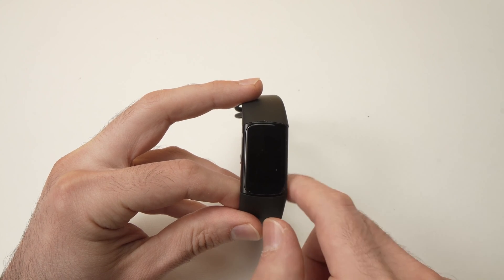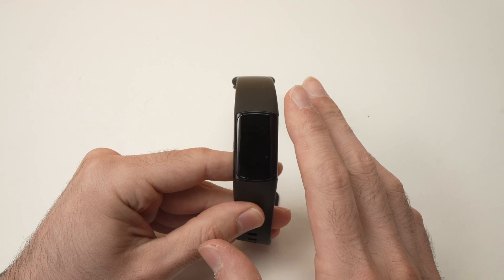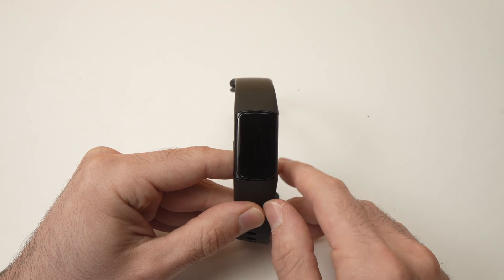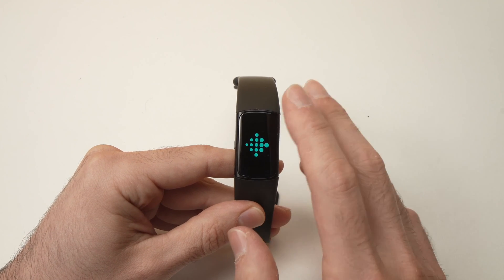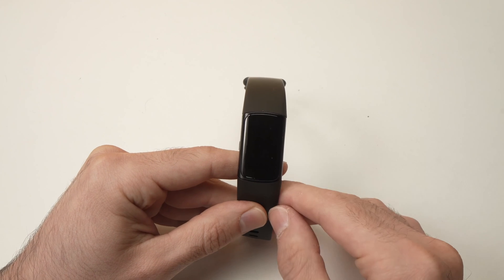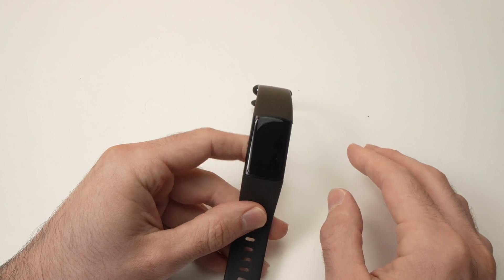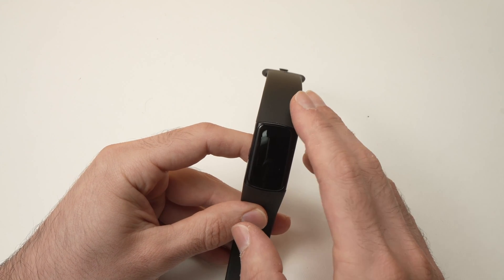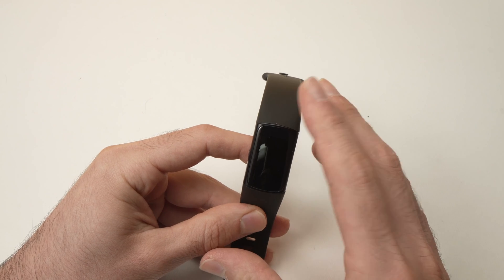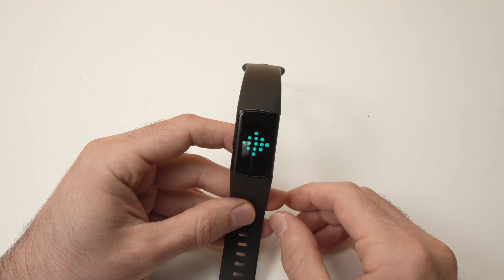You can release. Now I just have to wait because the Fitbit will shut down and turn back on after it has deleted everything. Just be patient and do not touch anything during this process. I also suggest you do this while having a full battery, so the watch does not shut down in the middle of a factory reset, because this can break your watch.